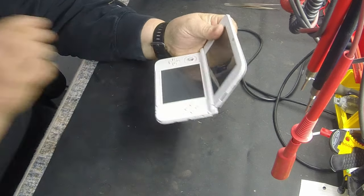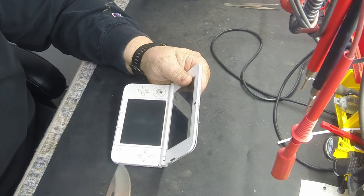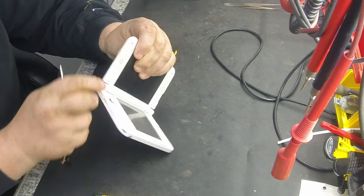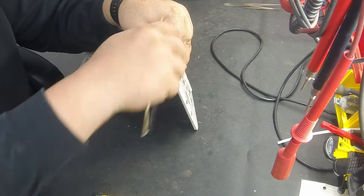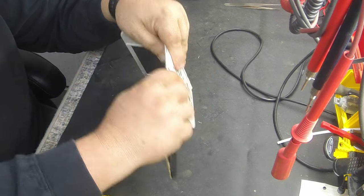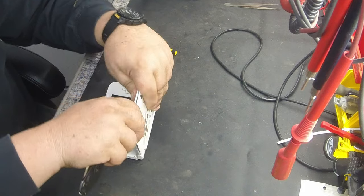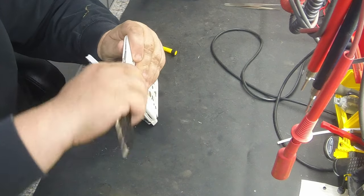Next you're going to want to use a knife or an exacto knife — a guitar pick works really well too. You want something with a nice thin rigid blade. I always start on the side without the 3D slider. Get down in the corner, find that little crack, and get it in there. Don't push too hard because there are components inside — you just want to work the edge in and snap it. Work your way around unsnapping it all the way around. This one I've had off before so it's a little easier.